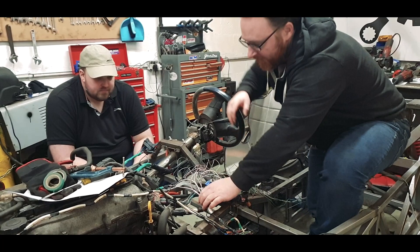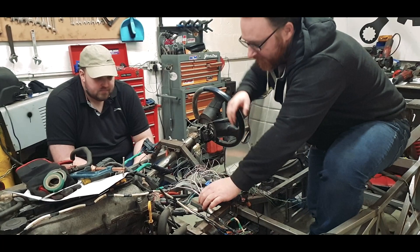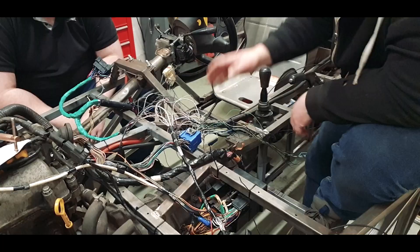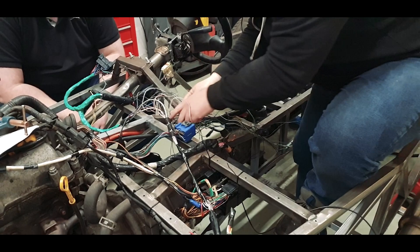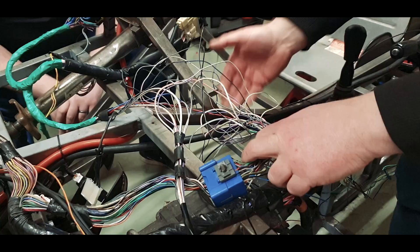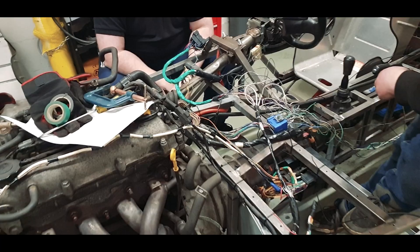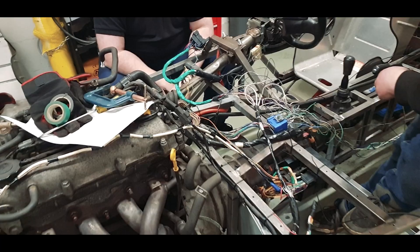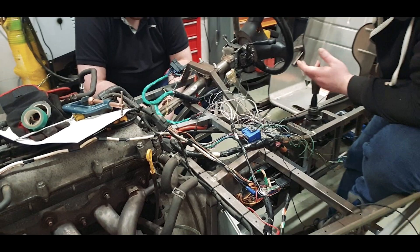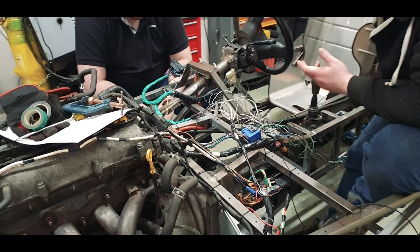We know that we've got one king wire running from here to here - that's going to be mandatory. We've also got lots of excess for various things that have lived in various places that don't necessarily need that length. You'll see we've got one red here which is the tight point and it's shorter than just about every other wire. So long as I have a way to chop, lengthen, shorten or whatever - so is that what we're going to be doing? Just cutting all these down so they're all nice and tidy? Things that used to spark to about seven or eight different circuits we're going to break off and, wire by wire, join them to the length they need to be as one wire. This is going to be us for the next three years.